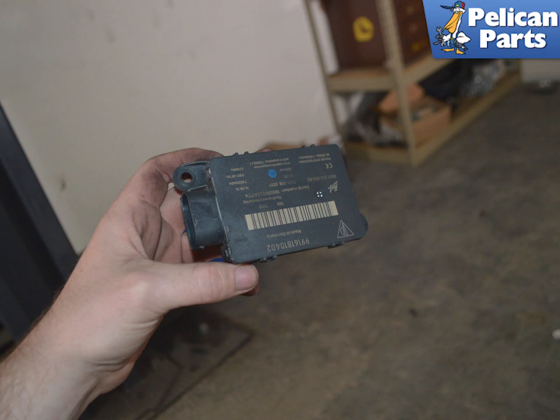Torque all fasteners on the underbody tray to 2.8 Nm or two foot-pounds. If the control unit is replaced, it must be programmed with your scan tool. It needs to know the relevant vehicle, country, version, and equipment. Reconnect the battery, plug in your scan tool, and turn the ignition on. Select the special functions menu and erase all fault memories. Use the automatic search of the control unit, select write-in data, and install data readout. Your scan tool should display coding writing incomplete.